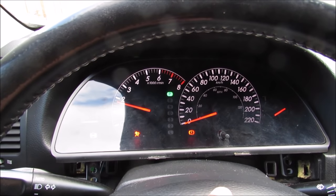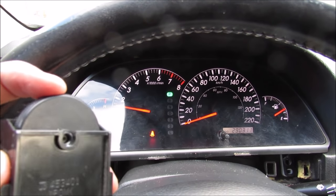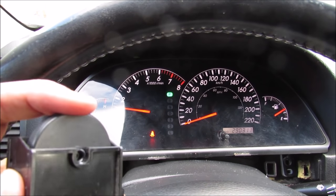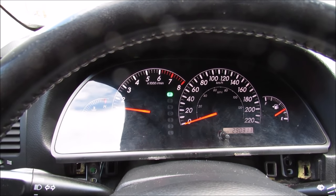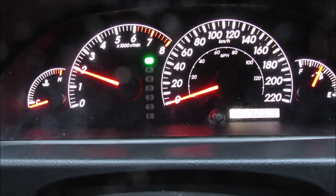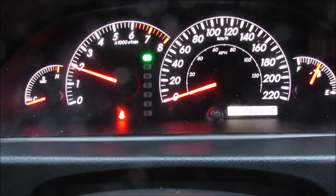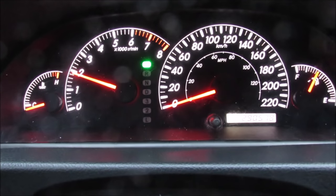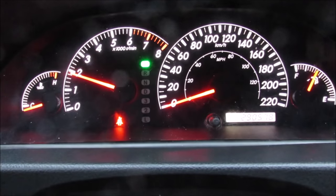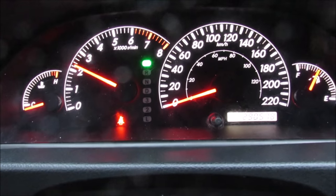I'm going to start up the vehicle and pay attention to all the warning lights to make sure that they work. You can see across the bottom there all the warning lights come on. I've also got my rheostat wired in and I can lower the brightness and make it much brighter. When I turn the headlights on the new instrument cluster dims. After driving on this cluster for a week and about 250 kilometers, everything works except the tachometer is reading a little bit high — at idle it's reading 2000 RPM, and if I really punch it the engine almost redlines.